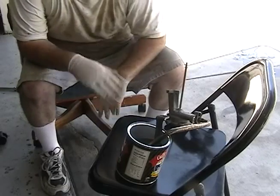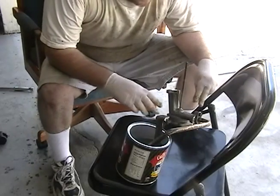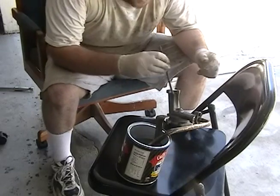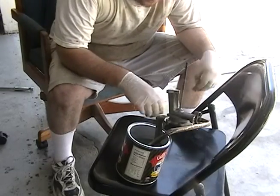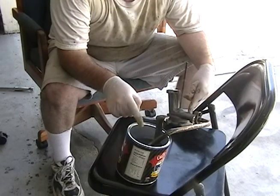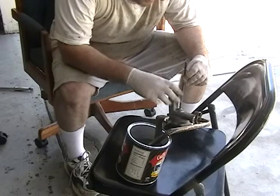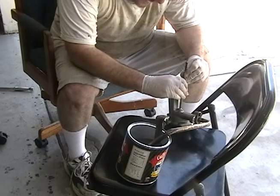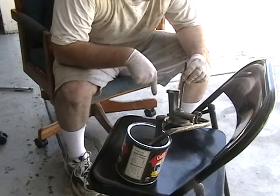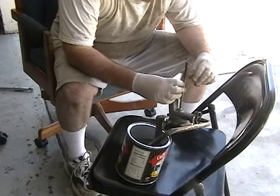I went with the old pump - I cleaned it and it seems to be good. I've got the pump drive shaft here and the pump is just sitting in some oil. The pickup is just sitting in a bucket of oil. All we're looking for is to get the oil to come out the top to lubricate everything. We go counterclockwise looking from where the oil will come out.